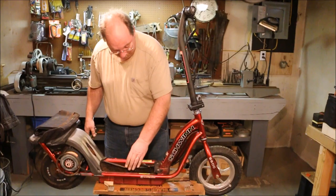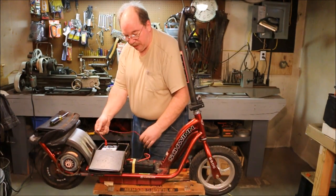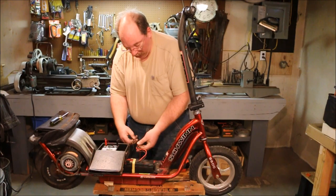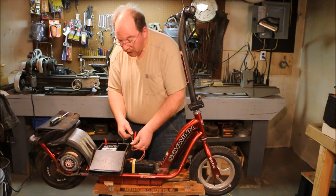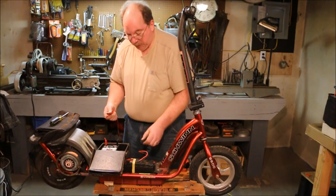Well, when I connected the battery to the cables and turned on the switch, nothing happened. So I brought it down here, got out my Fairy test meter, had this for a long, long time. It's something that I got when I was working with Dad. This is a 24-volt battery pack, two 12-volt lead-acid batteries. And it's showing that it has 14 volts. So that's good. I had it on the charger and it took a little bit of charge. It's showing more than having just one battery connected. So that's a very positive thing.